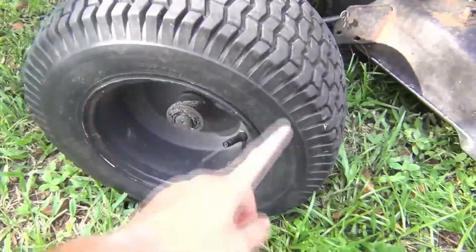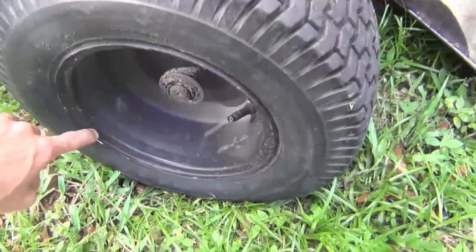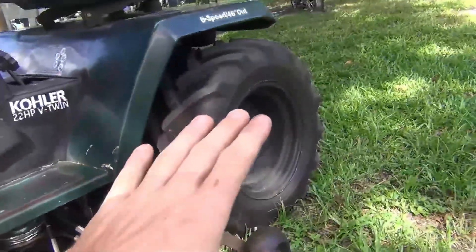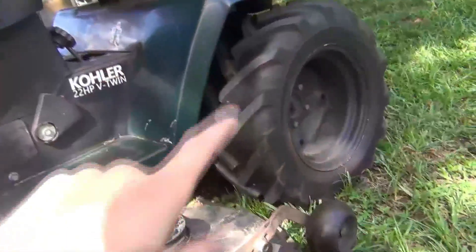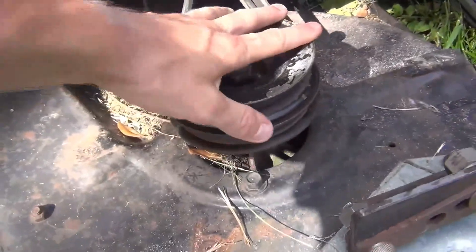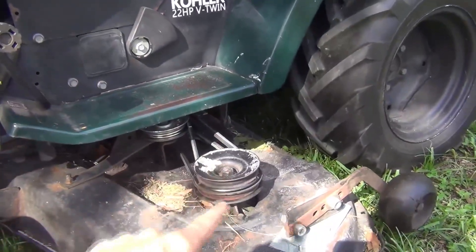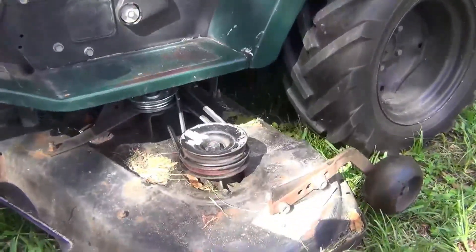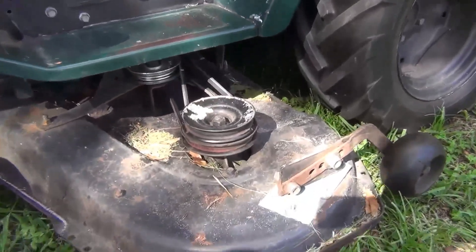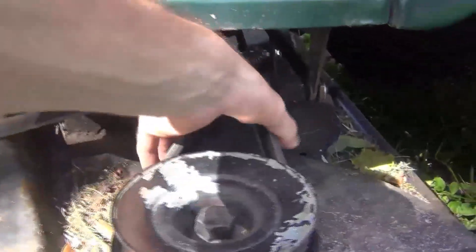A closer look at the wheels — I did put coats of primer and black paint on them. It is scratching a little bit, but it's still a very good mower. These are the stock original front tires. The rear tires I've talked about in a past episode. I've also never shown the deck setup — this is a dual belt setup on this pulley. The engine powers the belt, which comes to this pulley, which spins the bottom one, and that belt runs across all the blades. So instead of one single belt, it's actually got two, which gets expensive when they both wear out. I've had to replace the idler before, but replacing belts about every six months is about all I have to do to keep it running.